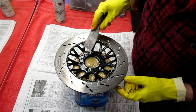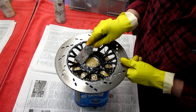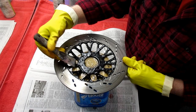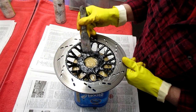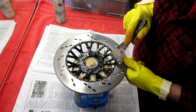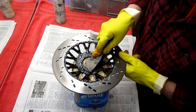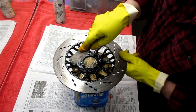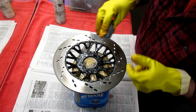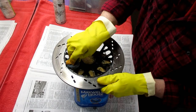A few minutes have gone by. I've got an ordinary paint spatula scraper, and it looks like that's loosening up the paint pretty well. The paint remover is going to work against the paint we have on there, so we'll just let this sit another minute and start taking it off. Because it's painted black underneath you can't really tell - that factory paint is probably baked on. The stuff I put on though, we'll get that off. With ordinary steel wool it seems to take some of it off - the more I can get off this way, the less grinding for me later.